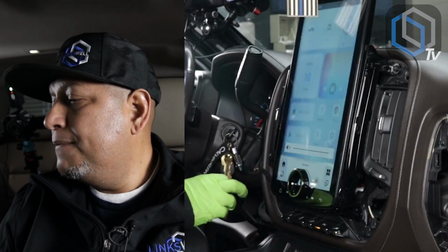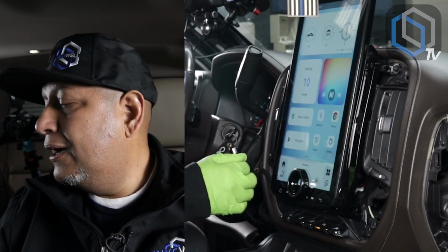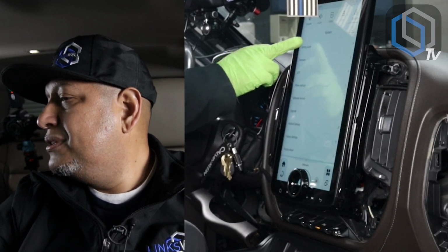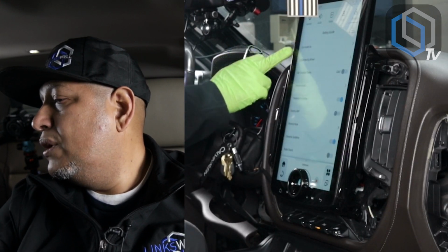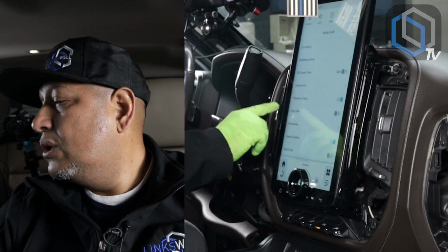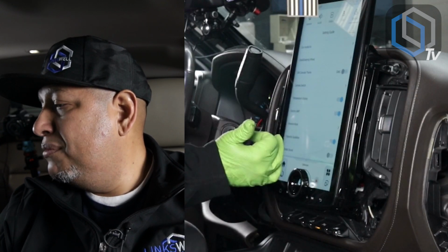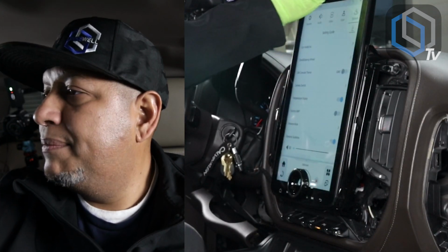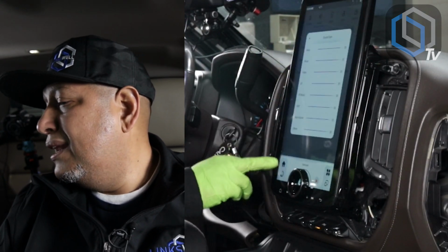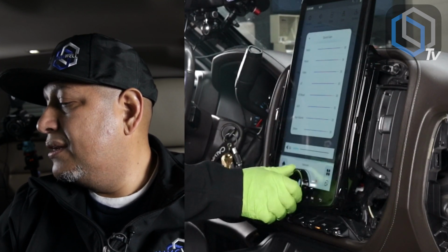you're playing. Next thing, what I will do is, if you notice that the volume is a little low, like I just did, go into settings, upper right hand corner, go to system, first option, setting guide, 1, 2, 3, 4, 5, 6 option, factory amp is off, so make sure that's off, because if it's on, it's going to lower the volume. If I go to audio up at the top, I'm going to go into sound gain, and I'm going to increase others. That's my CarPlay audio. We're going to make sure that I can turn that up.